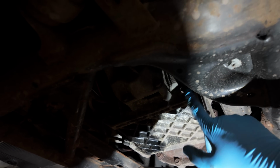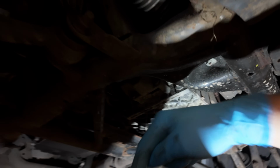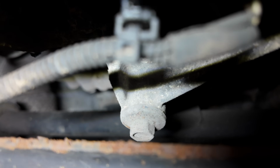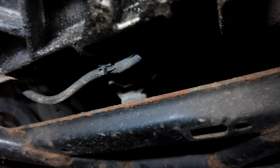Okay, so the first drain plug is just up here, so we can see that there. That one's not going to be too bad to get to, but when we take that out, it will just piss oil all over here. So I'm going to put a bit of cardboard up in here, wedge it up so when it shoots out, hits that, comes down into our drain pan. And then up here, somewhere, where's my torch? Let me show you. In there, you can just see that. That is the drain plug for the turbo, so we're going to do that one as well, but again, located in a great spot that it's just going to pour into this and then it'll come out of these two holes here. So yeah, I think that's the best we can do with that. But we'll do the front one first, get the majority out, and then we'll just dribble it out there, and it shouldn't be too much in that one.